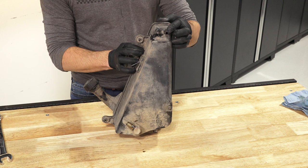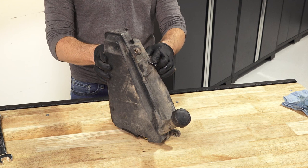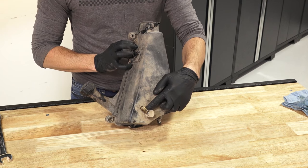Next, slide the clamp off the upper vent hose on the tank. This procedure may be difficult on these models and may require removal of the oil tank. Then, remove the middle vent hose on the oil tank. Note that on X2 and Touring models, the screen fitting on the tank is difficult to access. Removing the tank will aid in clearance.